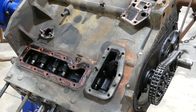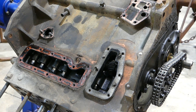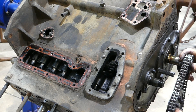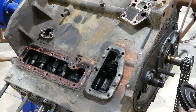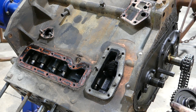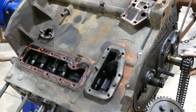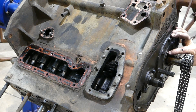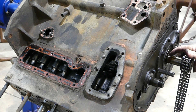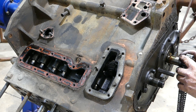That's quite loose really. Now grab a couple of little bars and we're pulling the crank gear off over the key — away you go. The key just fell out of the camshaft here, but that's no problem, we can sort that out later. Now I can see a dot here on the gear. We'll have to run through timing this engine again when we do ours. You can see shims here on the crank — that spaces it up so your timing train runs true and you don't get wear from it running one way.